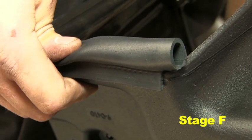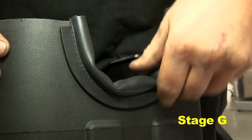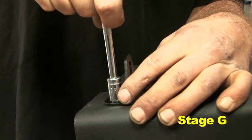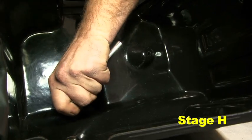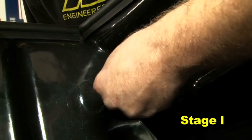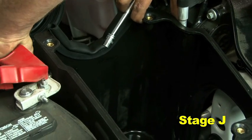Install the 24-inch and 6-inch edge trim around the AEM lower airbox inlet, trimming as needed. Install the 9-inch edge trim on the lower side hole of the AEM lower airbox. Also install the mounting bracket part 32-3079 using the provided M6 bolts and washers. Install the two barbs part 2-780 using the provided M6 bolts and washers. Install one barb on the inside of the lower airbox using one M6 bolt and washer. Install the lower portion of the AEM airbox and secure it with one M6 bolt.